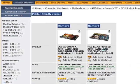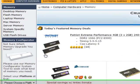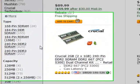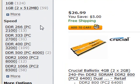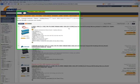The next part is the memory. It used to be that memory had all sorts of different voltages, but now it's not so important. I don't recommend using this little platform thing. Just go to desktop memory and check out 240. Okay, I can go from right here. Speed: we want DDR2 1066, because that's what our motherboard can handle. You want to go right to the best speed you can get.